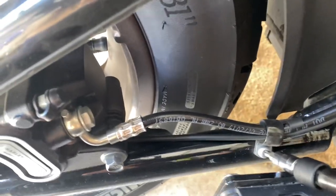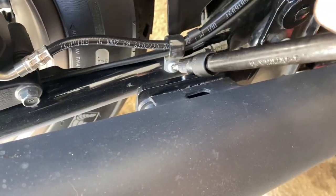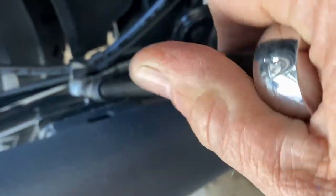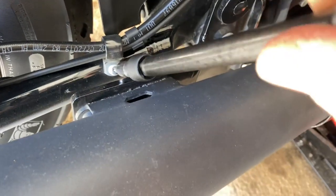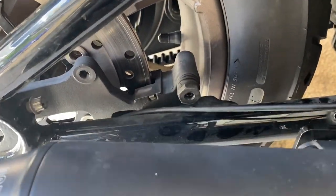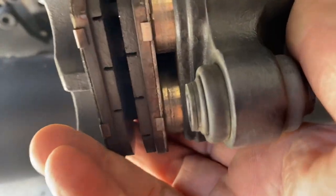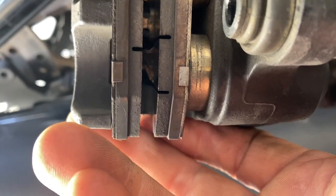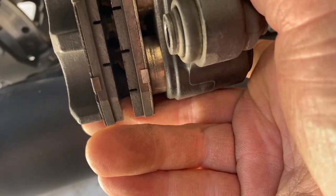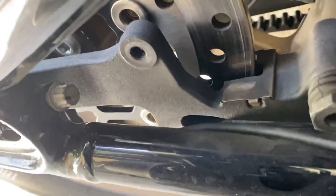We have to take this caliper off — it'll give me more room to get it out of the way. I'm also going to do my rear brake pads; it's time, and it's time to do the front pads also. 12 millimeter to get your caliper off — this one and this one — get both of those off. The caliper bolts off the bracket, you can pull the caliper off to the side. I still had some rear brake pad left at 25,000 miles, but I got new pads. I'm gonna clean up the caliper real good and put new pads on — there's the caliper bracket.